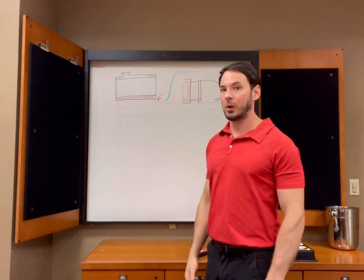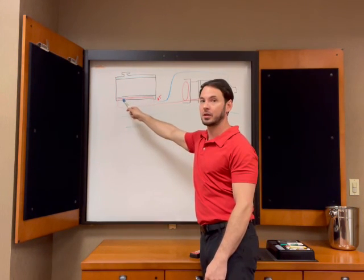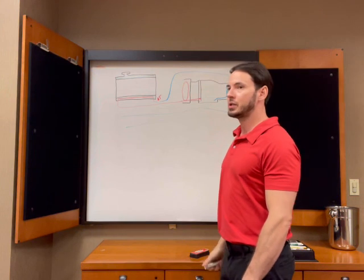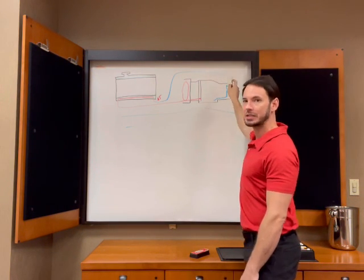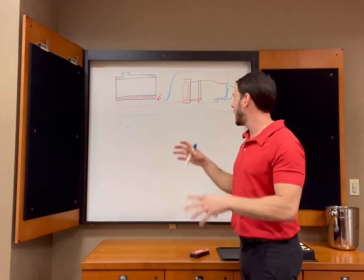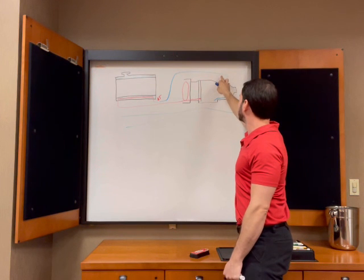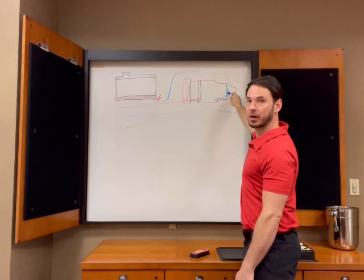Okay, cool. Well, what happens if, like in the early cars, this actually gets clogged? Well, in a decision that I will never understand, as I mentioned earlier, this fluid here actually does something when it comes back. It actually sprays over a bearing and lubricates part of the rear planetary. It just sprinkles over it. So if this fluid is completely interrupted, you'll seize this back bearing.